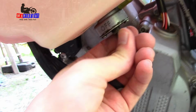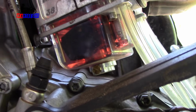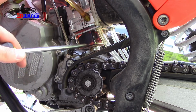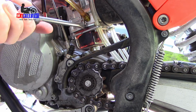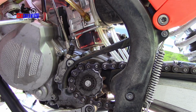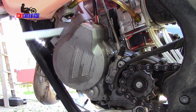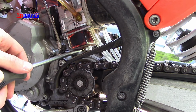Whatever it is, I'm gonna turn the gas off. Alright, I'm gonna try draining a little bit from there and see what happens. So we're gonna drain this here, and what I think is happening is that too much fuel is filling up. It's going too high in the carb, that it's actually going into the cylinder, flooding it out, and then causing it to be way too rich, and that's why it's not starting right now, and that's why it ends up going out the exhaust pipe or leaking out the cylinder exhaust port there. So I believe this is where you can drain it from.